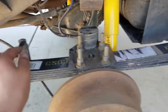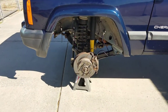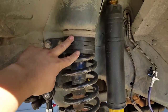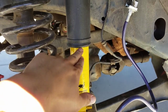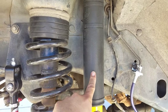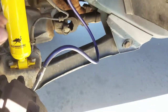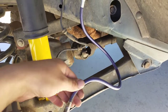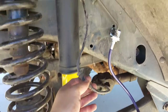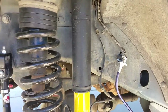Now let's look at the front. What was provided with the lift for the front was the Currie Springs two-inch spacer and the Old Man Emu suspension shock absorber. The front ones come with a so-called dust boot that's plastic — I tried to take it off but it's apparently on there for a reason. I also bought aftermarket extended brake lines for the front; one side feeds this one, and the other side gets the other. I also disconnected the ABS line here — it just dangles but stays out of the way, and when fully flexed it can stretch but won't reach its full length.